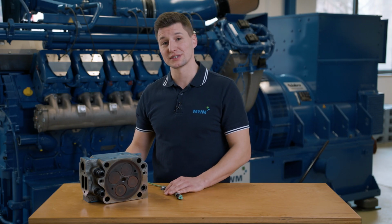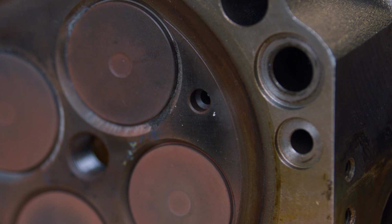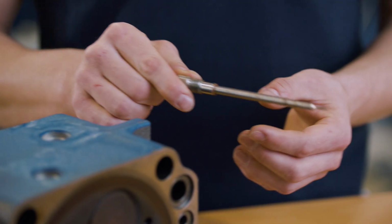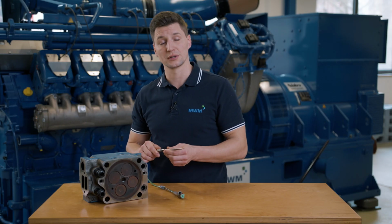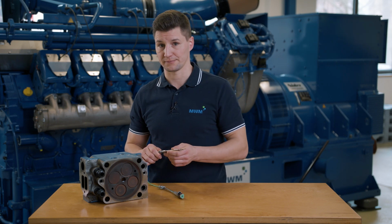The combustion chamber temperature sensor is screwed into the cylinder head and protrudes into the combustion chamber. As all sensors should measure at the same point, you need to check whether the old gasket is still stuck in the cylinder head. If that is the case, be sure to remove it, as otherwise you would have two gaskets after installing the new gasket. As a result, the sensor would not protrude far enough into the combustion chamber or could leak.